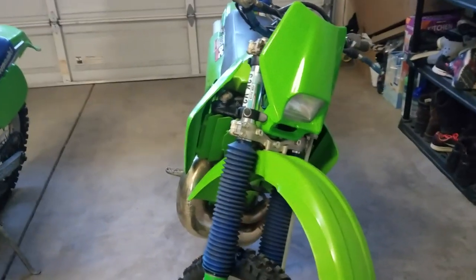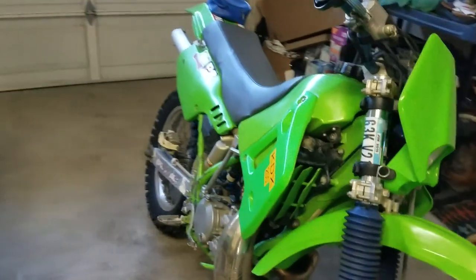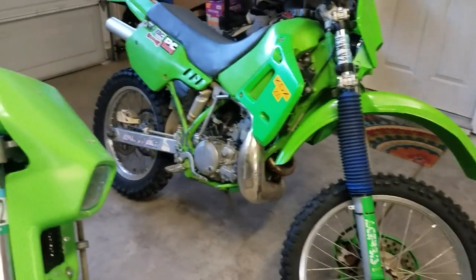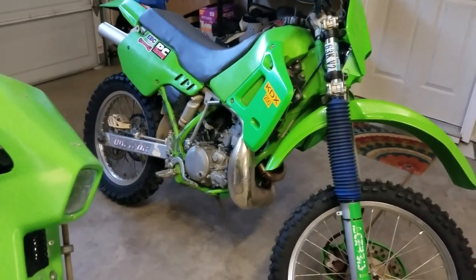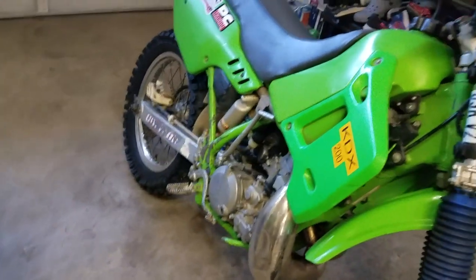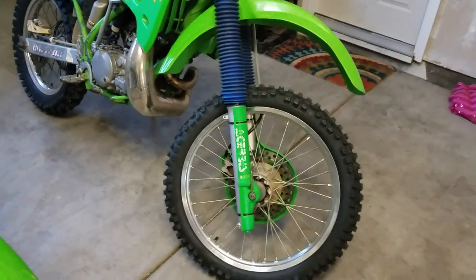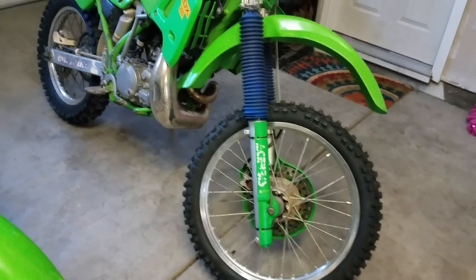While I was doing the restoration I happened to find this 1991 KDX200 on Craigslist. It didn't look like this when I got it — I bought it from some guy nearby for 800 bucks. Mechanically it was all there, really good condition. The motor was strong, he did the top end on it — piston and everything. Suspension was okay but it needed fork seals, so I had the front fork seals replaced with new fluid. I put brand new Michelin Battle Cross tires on it.